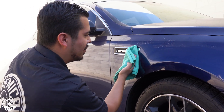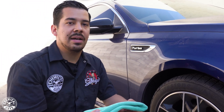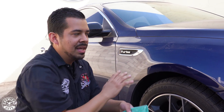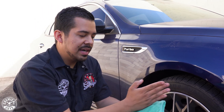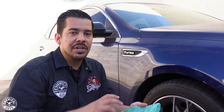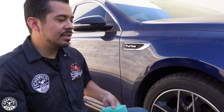When you wipe, you want to make sure that you roll your wrist as you wipe to prevent dirt lines on your towel. What you don't want to do is put all your pressure on your hand and do one clean sweep, because all that dirt will accumulate on the microfiber fibers and create a dirt border that drags along the paintwork. You want the microfiber strands to pick up the dirt and grime off the surface so you don't scratch it.